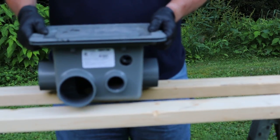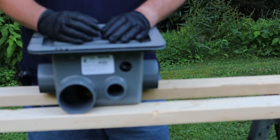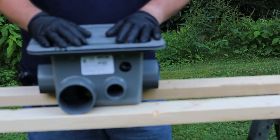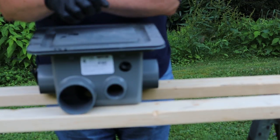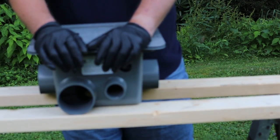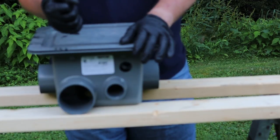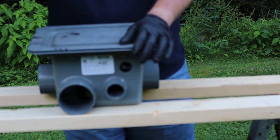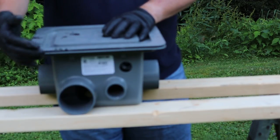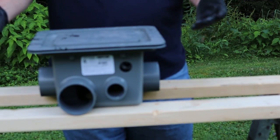The pump hose is about the size of a vacuum cleaner hose. It's probably got a 20-foot hose on it with a fitting that goes into a threaded sewer inlet at campgrounds. What this thing does is when you open your valves on your black tanks and gray tanks, whatever's in those tanks comes into this housing and either bypasses the macerator pump out one of the three-inch outlets to a normal stinky slinky sewer hose, or if you want to macerate, you pull your valves, turn the macerator on, and it pumps out through the smaller hose.